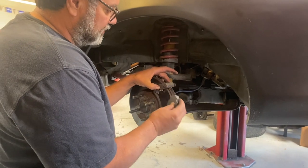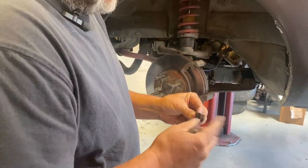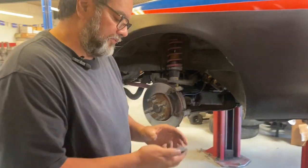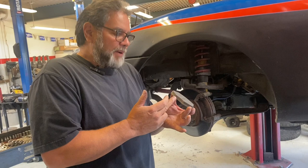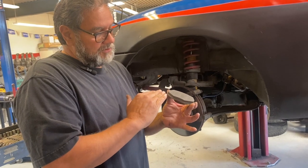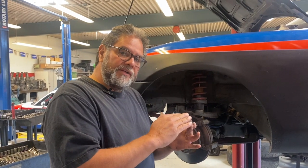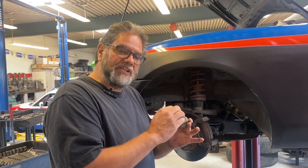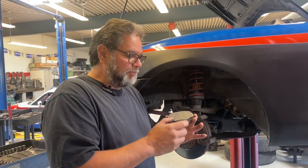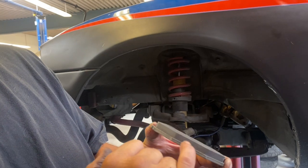This is if I have plenty of time to do the brake job. The next step is I'm going to pull these pads out. They've got these little anti-rattle shields - you can buy these, they're in pretty good shape. It's a good idea to pick them up if you're missing some or if they're destroyed. This is a racing brake pad - obvious because this is a race car. Racing brake pads differ from regular organic pads in that the brake lining material itself has a great deal of metallic in it to withstand high temperatures and the braking needed to slow this car down from high speeds.